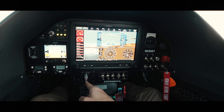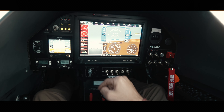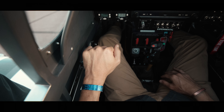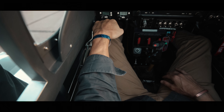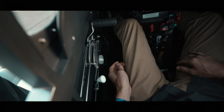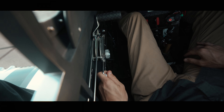The flap position is shown here — flap is currently full down, so it's flap three. I can also show you the trim. The power quadrant is here: this black one is my power lever, down here is the propeller lever, and there is also a friction lever to adjust friction. And here is the tail lock mechanism.